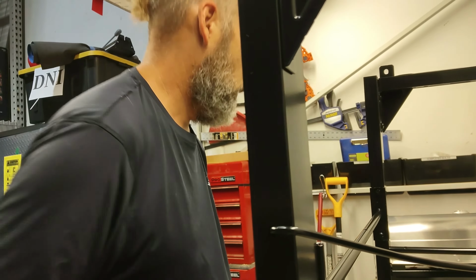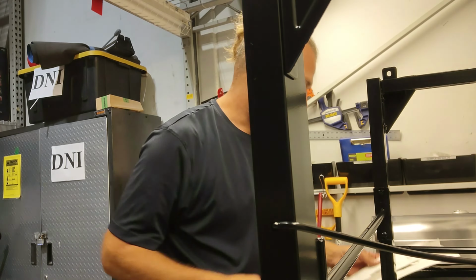Now, normally these have a heat shield. If they have a heat shield, sometimes they do. This one doesn't, because the grease pan is the heat shield on this one. That's the newer ones. Oh, this doesn't even have the hole for the heat shield. The heat shield would go on the side with the propane holder. It would tack up in there with your other two Bs. Okay, no heat shield. Grease pan is the heat shield on this one.